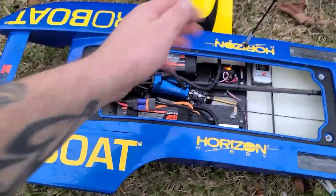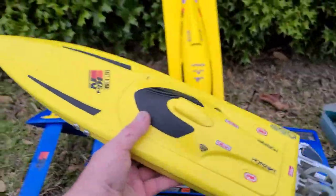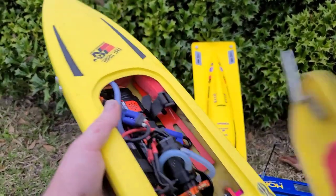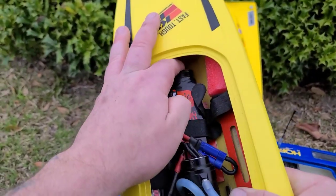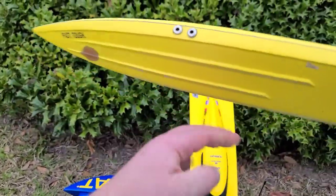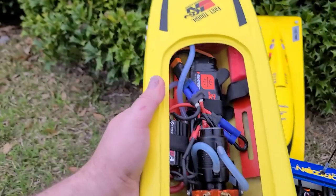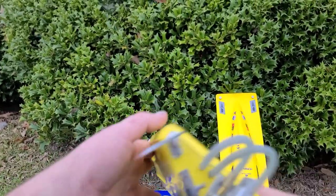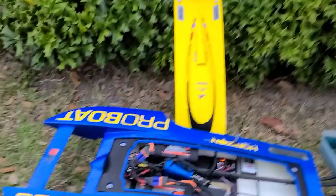That freaking 4074 was getting off, son. My little Delta Force — I kind of like it with the battery down low. I remember why I didn't run the boat with the battery down low — my CG is a little bit forward, wanted it to ride on its keel and veer with steering. When I run it on the side I can push it back farther and it actually offsets some of the torque roll. That's the hobby — switching stuff around, putting different motors in your boats, tinkering and testing. That's what I love about RC.